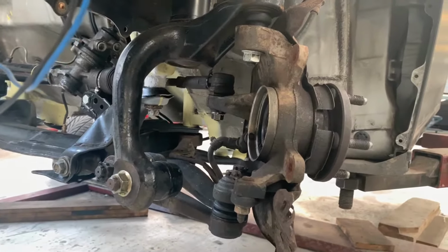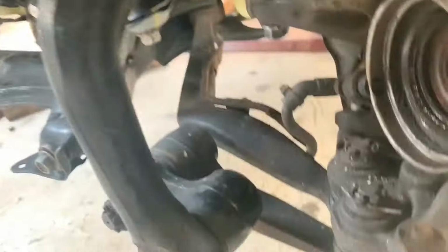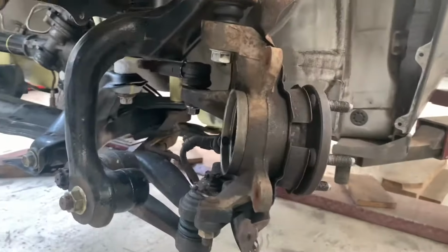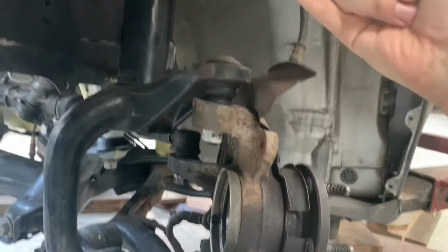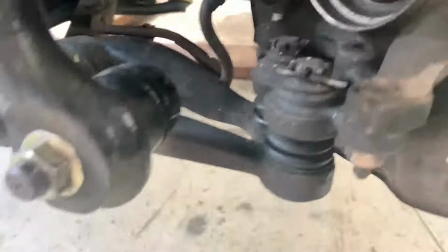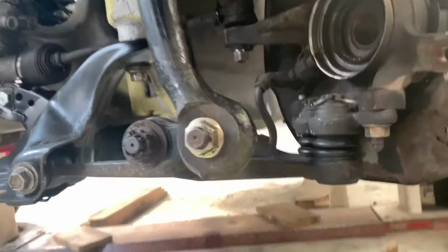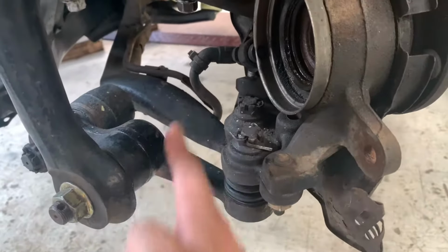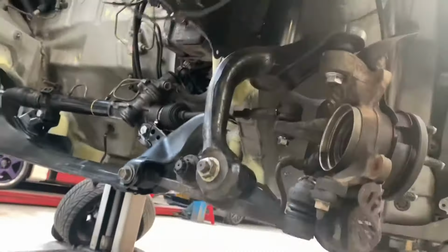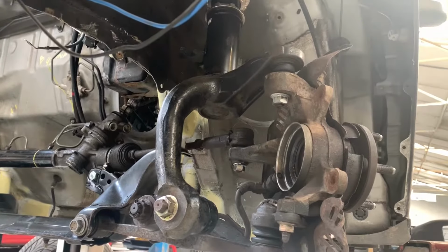And here's that super strut I've been telling you guys about. As you can see, the McPherson leg doesn't sit on the, technically not McPherson, because it's not like one piece with the hub. So the hub is actually loose from the strut. It connects over there, and here the hub connects. This is spring loaded, so that moves. So that's connected to that arm, which should help a lot with torque steer. It's actually very, very complicated, because all these arms, they move in relation to each other when you steer the car. But apparently it works really well. It's devised from rallying, and it should really work with high power applications on front-wheel drive cars.